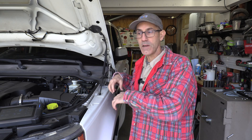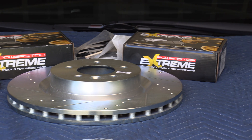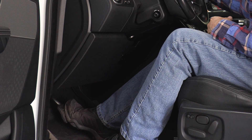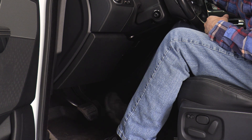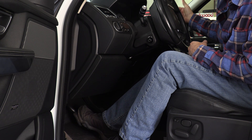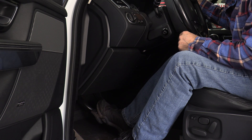This vehicle needed brakes, so I put a whole set of PowerStop Z36 pads and rotors. Then a month after that, I did a full brake fluid flush thinking I could get that pedal feel better. I put a quart of brake fluid through this thing, just bled it to the best of my abilities. The pedal never changed — it was always long and soft. And what led me to believe something was still wrong was the fact that as I pumped the pedal, the second pump was always much firmer and much closer to the top of the pedal stroke.